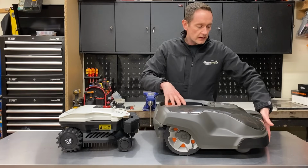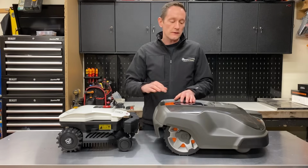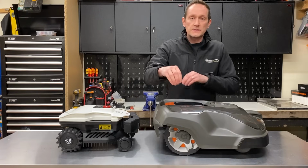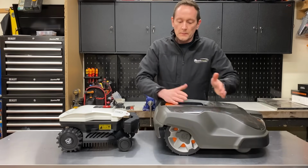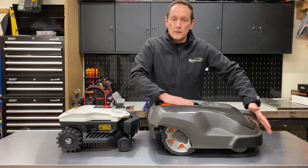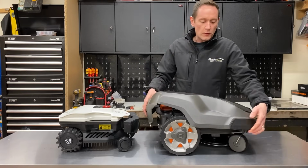If something is hit head on and forces the cover directly backwards, the robot can reverse back, turn around and change direction. This is achieved because the top cover is mounted on 3 plastic ball joints which are spring loaded, which allow this free movement but make the cover always return back to a neutral position. I'll remove this top cover and show you how that works.